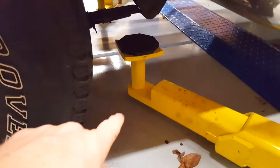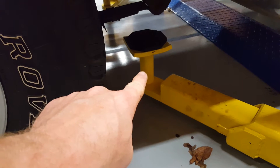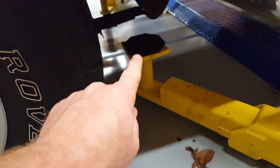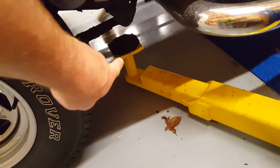This is a 9,000 pound lift and I have the truck adapters — these tall cylindrical shaped pieces of steel below the pad — and the little bracket on the back side of the post where you can put your adapters. These are the small ones for regular size cars, and if you have a truck that's a little taller you put the long ones on it. Not rocket science.